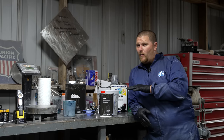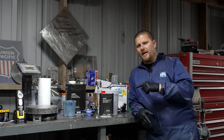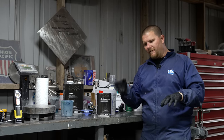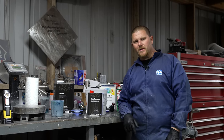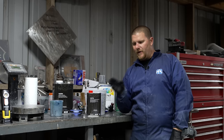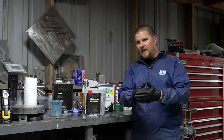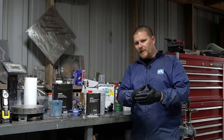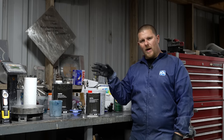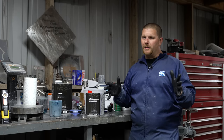So it could take quite a while to get through five coats, but the benefit of doing them all at one time is that if you were to do a flow coat, doing three coats, sanding it and clearing it again, if your final round only had three coats, you do not have six coats, you have three. And the reason is if you're color sanding and polishing and you burn through to the very first round that you did the day before, it's still going to show a halo where you polished it. Where if you do all of them at one time and account for that flash time, account for the grit that you're going to be polishing.